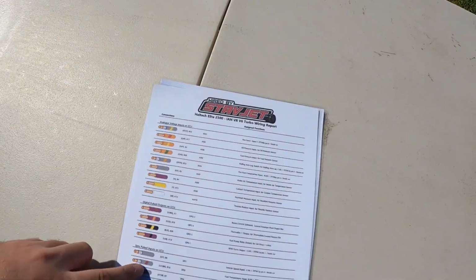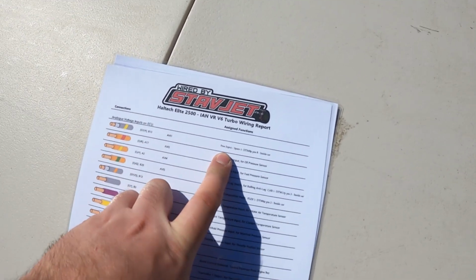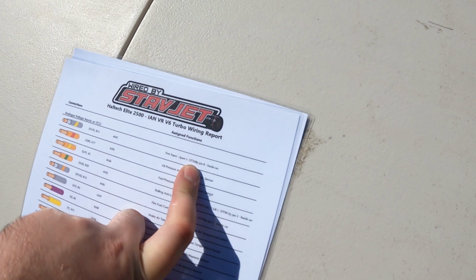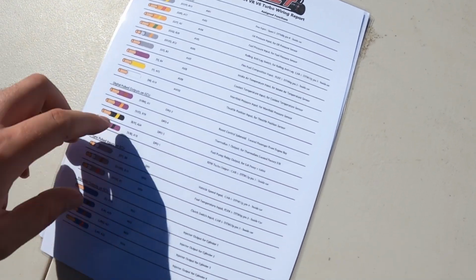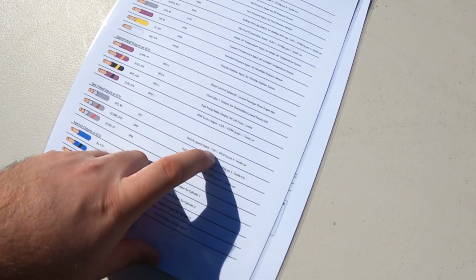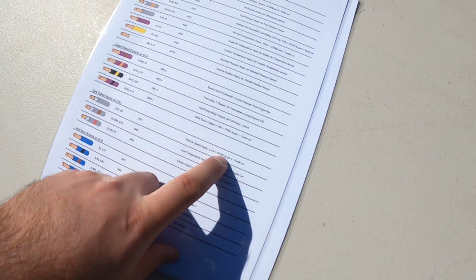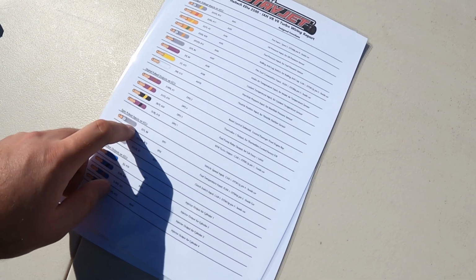So setting it up in the ECU, and then mapping out your wiring. You've got the wire colors here, and then you've got, for instance, free input, spare one, so connector spare one, DTM 8 pin on pin 8 inside car. So I actually go through each of these inputs, outputs, whatever's going in the car. It's defined by a connector, which is engraved on the connector, the pin count on the connector, and what pin this particular wire is. So again, plan, map out your harness.